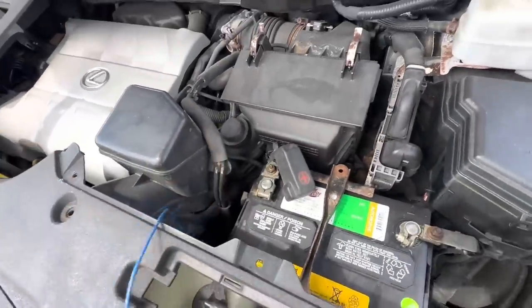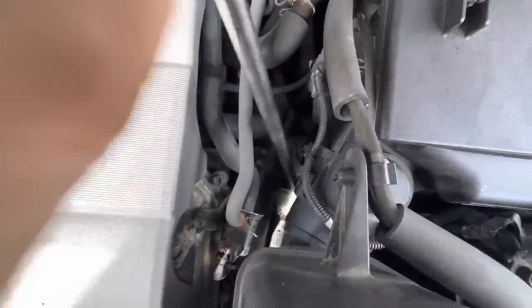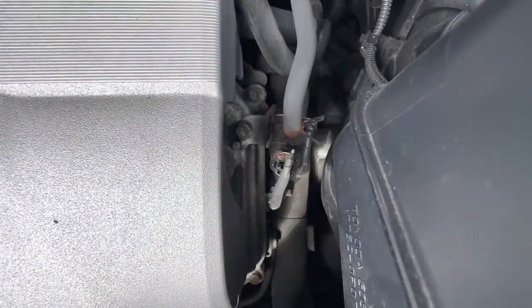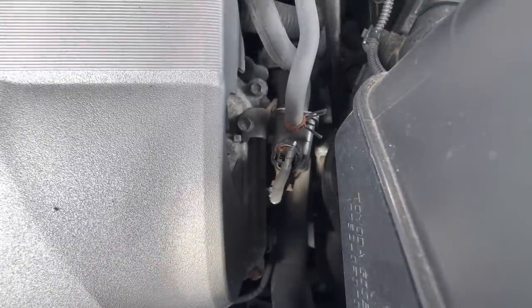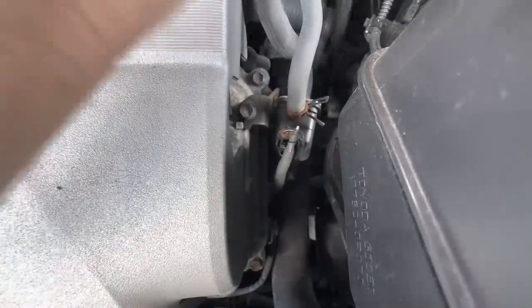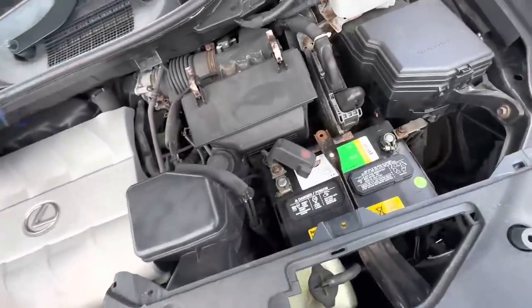It said no. Okay, here, I brought an extension with me. The starter solenoid is right down there. It's going to bang on it some. Try again. It's negative. It's reluctant. Let's try one more time here. Holding power onto the starter. Thing's fried. Yeah, it's not going to happen. Okay, I give up. Gonna have to just replace this unit right here in the parking lot.